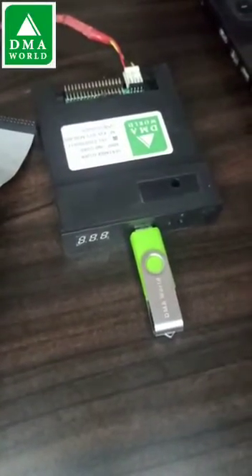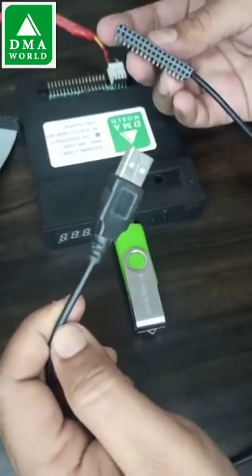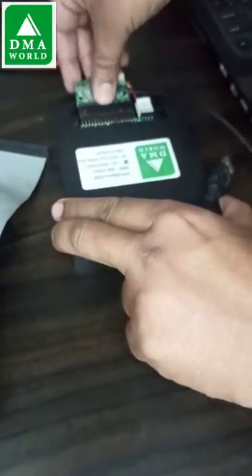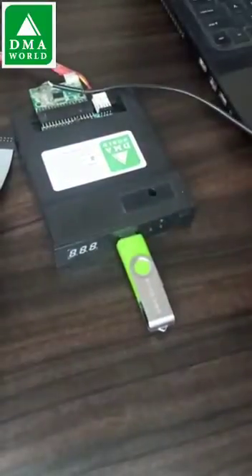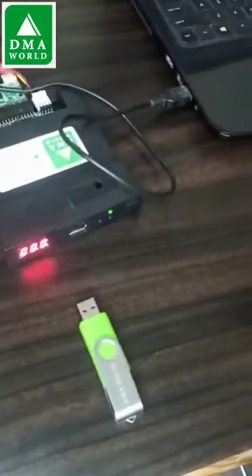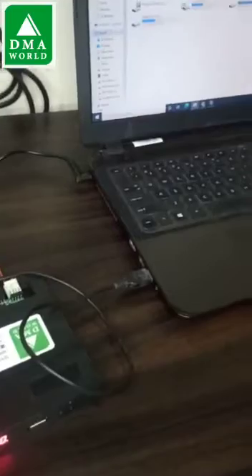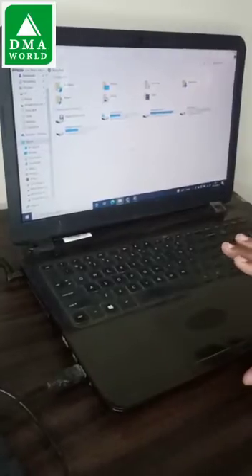Here I am going to show you on my laptop. I have a USB to FDD converter. I am going to connect the 5V DC connector — I already connected it. Now I am connecting it to my laptop, after removing the pen drive first, and powering on the 5V DC. After powering on the emulator, it will show you a floppy disk drive on your computer.